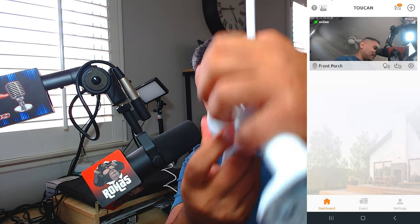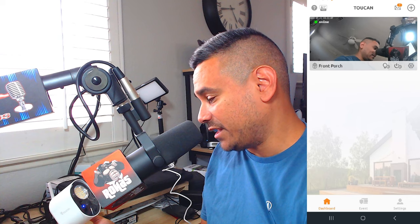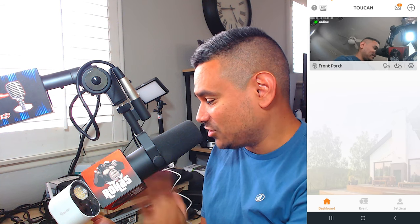A couple things that you can do. In the back of the camera there is going to be a setup button right there. All you have to do for a hard reset is hold it for about five seconds. Let's try this right now — one one-thousand, two one-thousand, three one-thousand, four one-thousand, five one-thousand... it should change red. Maybe seven, eight seconds — there it goes red. So about eight seconds it's going to change to red.